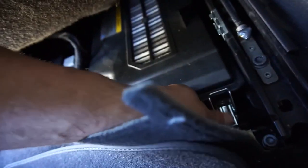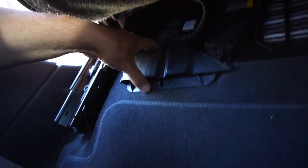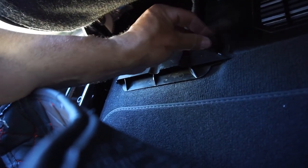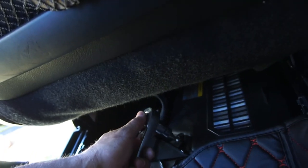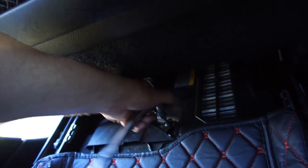Make sure you hook your clips on back here - that one there, and this one's kind of a pain to get to. Put that all back down. This piece goes over that piece - slap it in there like that. You have your screw - grab your little screw, it's just plastic going into plastic, so I'm just using a T25.